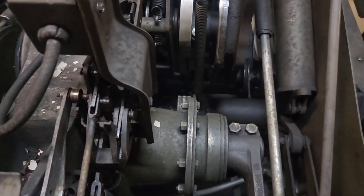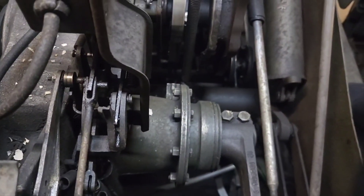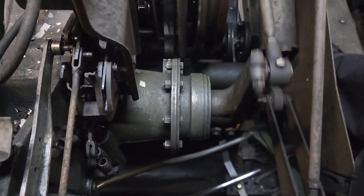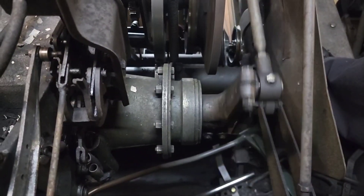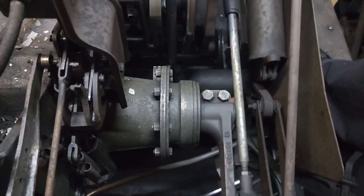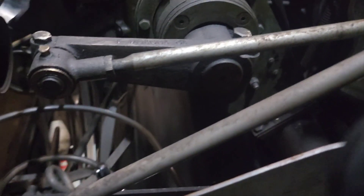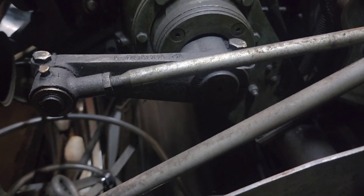The clutch is stopping a little high. I wonder if it coasted over — we'll have to get the gearbox clutch warmed up to find out. Yeah, that's stopping really high. That's too high. Let's go ahead and do a gearbox clutch adjustment.